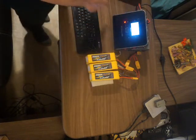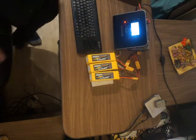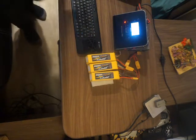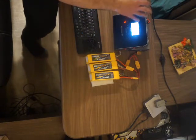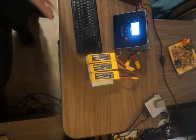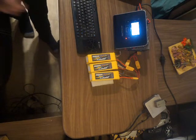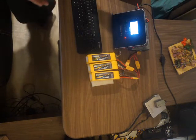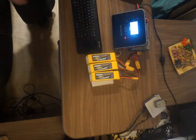By the time I'm done using one pack, the cells on the charger are fresh and ready to go, and I can just keep looping through batteries throughout the day. I don't have to worry about doing the walk of shame when the batteries are dead or being lost in the bush somewhere with dead batteries. So, straightforward lithium polymer with a really good balance charger. There are a number of these out there. You can trust my recommendation of going with the HiTec charger — I've been using this unit for almost five years non-stop. In the background I've got a little 15-volt, 20-amp power supply, but any 800-watt or 1000-watt computer power supply or fixed-voltage DC output is going to be just fine. You can also connect it to a car battery.